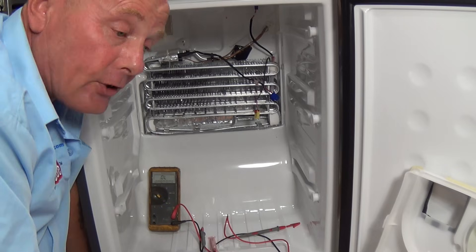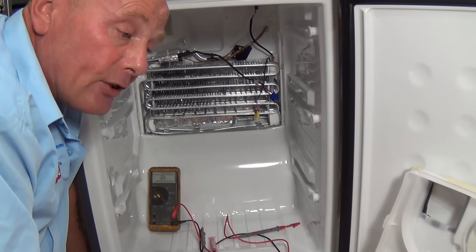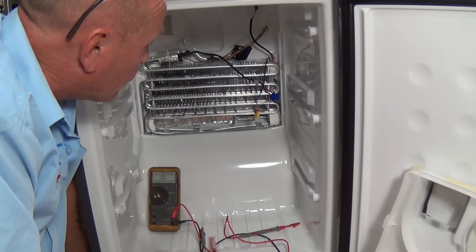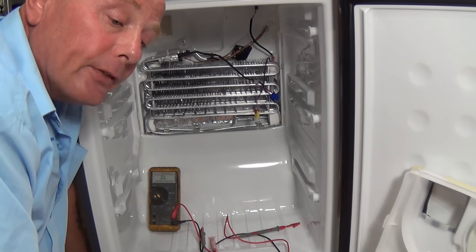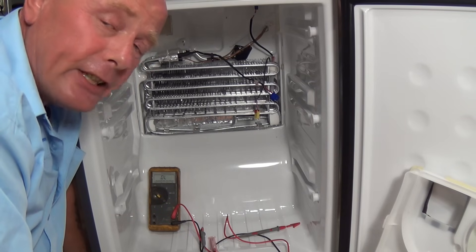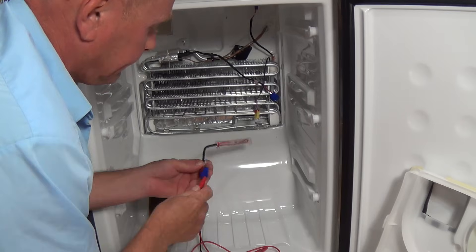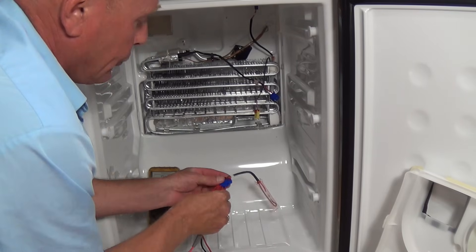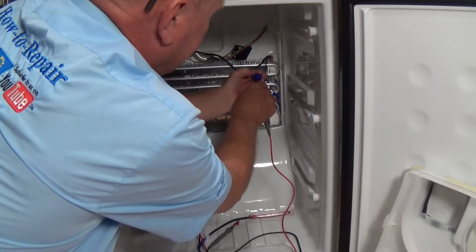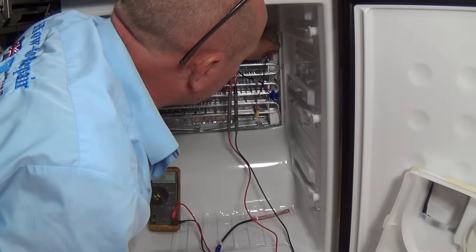We'll watch it on our graphing system — you've already seen the graph showing the defrost not working. What we need to do is look at how long the defrost element is actually on, to see if it's within the desired parameters. I think on this fridge freezer the printed circuit board runs at 12 to 13 hours. Let me just show you this defrost thermal fuse. We'll connect this up with the meter set on continuity — we have a circuit on the new one. We'll quickly test the old one — and as you can see, we do not have a circuit.